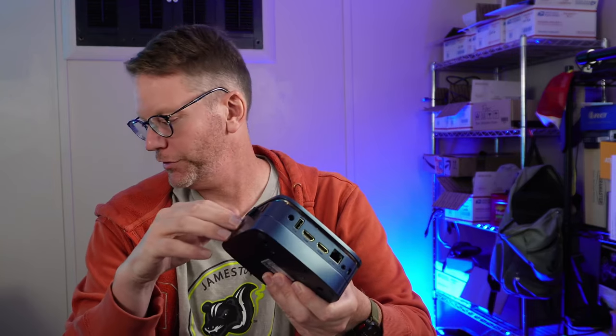So next, put your USB drive into your future server and plug everything in. You will need an Ethernet connection on this. It will work out best. And then once everything's turned on, you'll need to know how to get into your BIOS. Basically, what you can do is search your brand name and then BIOS key. For me, it's hit the escape key. Others, it's either F1, F2, F7, F10 are the most common ones. Also the delete key.